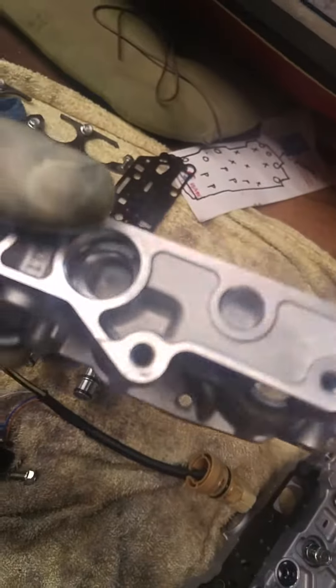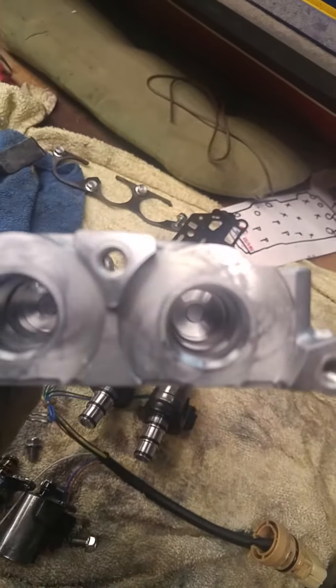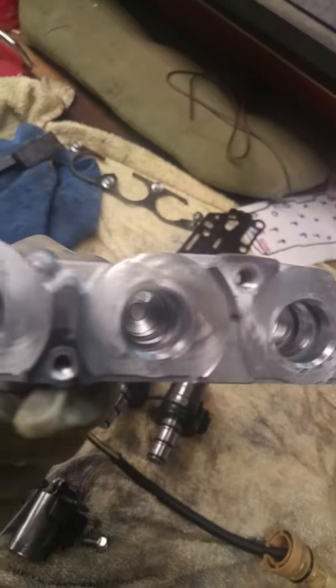Went ahead and cleaned this first little portion — this was for the solenoid clutch pack or solenoid shift pack. This thing was a little nasty so we're getting it nice and polished up and clean. Checking all our ports, making sure everything looks good. We're also gonna be testing these electronically with the voltmeter, checking the resistance on them, making sure everything is working.